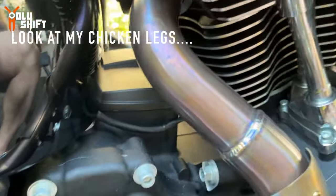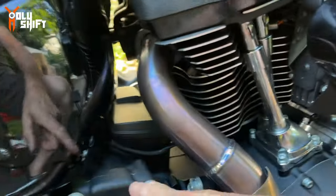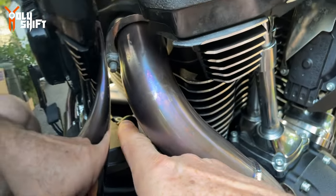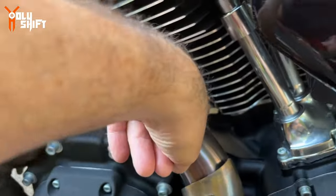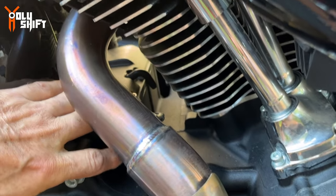The only thing is the access to these bolts. These are Allen bolts, 3/16, I think, and access to them is very difficult, especially on this Softail. So you need to take both covers off and then reach these six bolts. Do you see them? One over here. I'll show you as I go. Very tricky, a lot of gentle finger work. Some of my viewers, every time I say I can't get it in, and then I finally get it in, they all go berserk in the comments. Oh, I love it. Anyway, pretty funny. Same thing over here, it's a lot of gentle work getting access to these bolts. So let's start by taking the covers off.